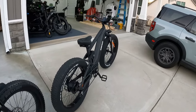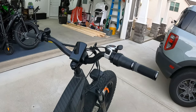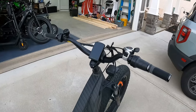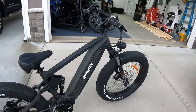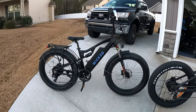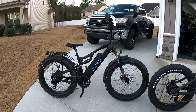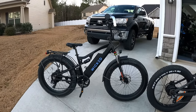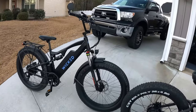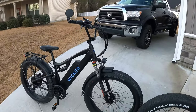The Freedom has really tall BMX-style handlebars, about 48 inches off the ground. I recently changed the handlebars and screen on the Cobra — I added a KD986 aftermarket screen, which keeps all the same programming but removes the speed limit, gives you a color screen, and gave me a couple miles per hour speed increase — it'll do 28 mph pretty easily now. The Wicked Freedom is way faster though; it goes close to 40 mph. I can hit 38 easily, and going downhill I've had it up to 42.